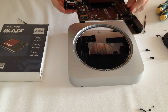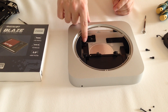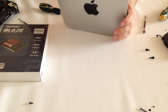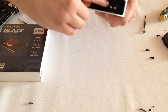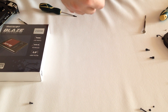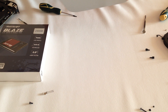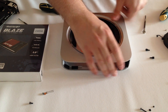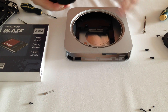This is it — this is your entire Mac Mini. Amazing, isn't it? Next we will need to remove the screw holding the power supply. The power jack is held down by a small metal bracket — we will need to remove this. Simply pull it to the side and the bracket comes right off. Now this next part is a bit tricky. After you remove the metal bracket, you will need to turn the power jack 90 degrees to the left in order to remove the power supply.